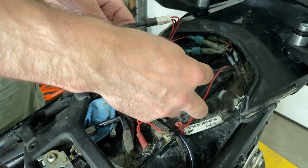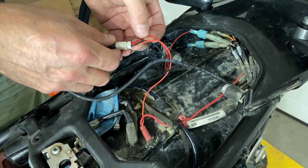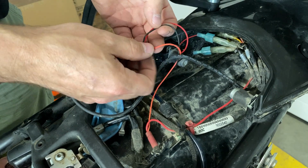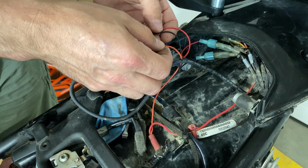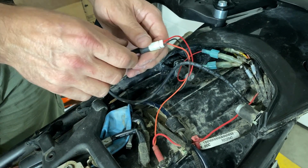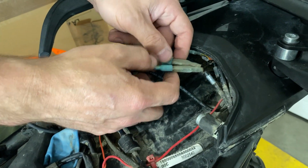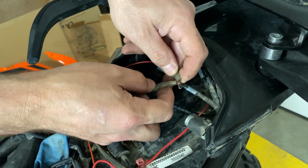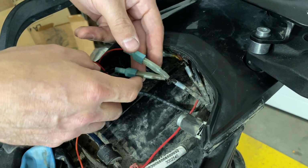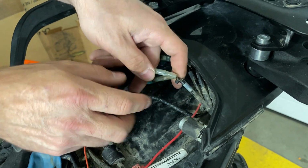This is the harness coming up from below from the B6 light. And what you've got is 3 wires: a ground, a hot, which is red, and then it's hard to notice, but this is orange. And that's the brake actuation light to get you the brighter brake signal. As opposed to using the harness from the Cansmart controller, I just use these 2 connections at the back of the bike here that are auxiliary, and that's the black with red stripe and this sort of reddish colored one. The ground is the pinkish red, and the keyed power is the black with red stripe.